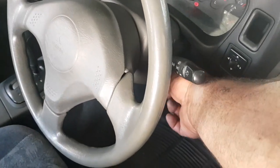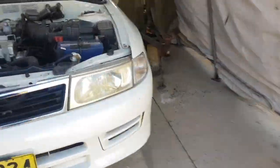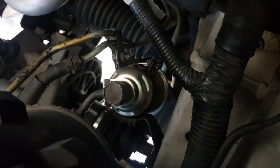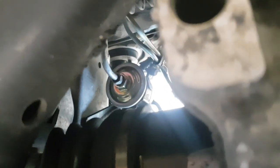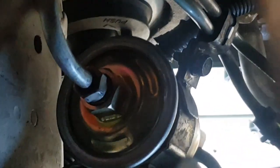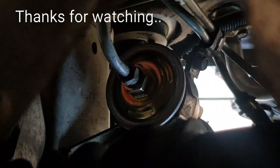Okay, that's on — now we'll kick her over and check for leaks. Start the car, it might take a few goes. Not bad — let it idle and we'll go check the leaks. Nothing coming out on the top line, nothing coming out on the bottom line. I think we've done all right for a couple of backyard boys. Alrighty, thanks again.